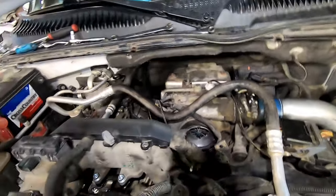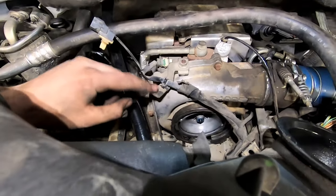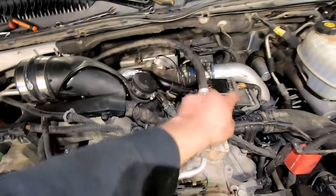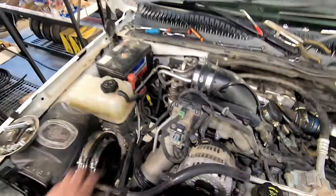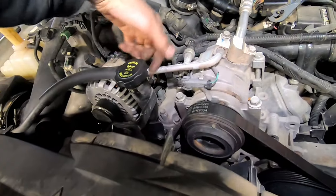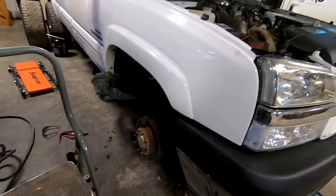That's going to be pretty much the last thing, then we'll just be doing up the electrical, getting your air intake back together, and putting your coolant in. This piece has a little plastic tab that rests on a bracket there so you know the position it'll sit in the truck. It's bolted down and the clamp's on. All wiring is hooked back up and bolted down — AC and coolant level sensor all good. Now we're going to put in the air intake, hook up the batteries, and fill the coolant. When filling the coolant, take that little screw out at the front of the thermostat housing to bleed the air — as soon as you see coolant pop out, put the screw back in.